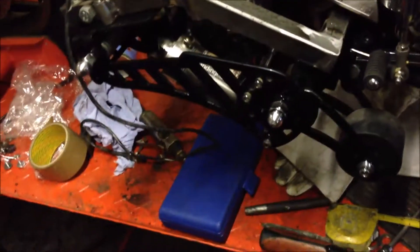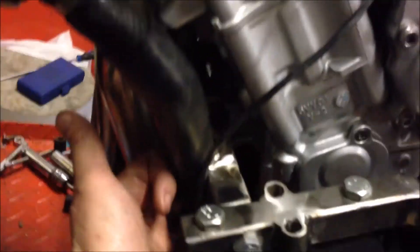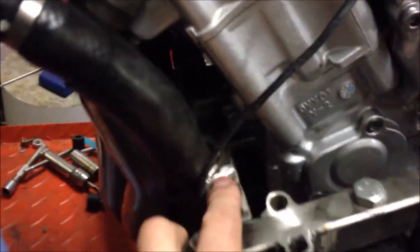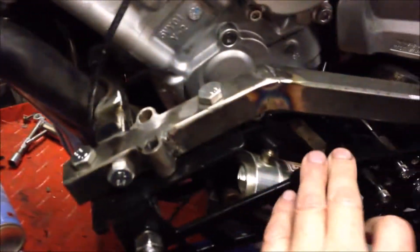This is how far we've got so far with making up the landing gear. As you can see, the landing gear is now mounted using the two engine lugs at the front, and we've custom made a bar to go through the middle there. This leg-up kit was originally for a 1700 Kawasaki. We've taken the original plates off and we're just using the wheels and the landing gear. All of the electrics, the compressor, all of the servos, and everything required to deploy the landing gear is inside this custom seat hump.